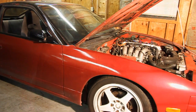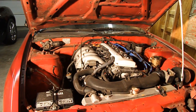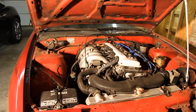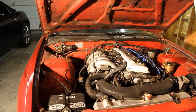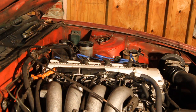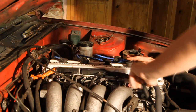I parked the car shortly after getting the Solstice due to finding excess fuel in the car's oil. This problem can be caused by a few things such as injector failure, injector o-ring failure, or seals. It could be an ignition system problem or even something as severe as a low compression cylinder causing a lack of combustion.